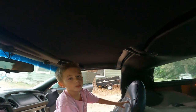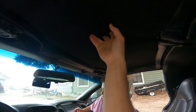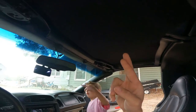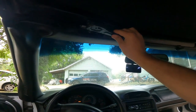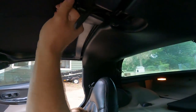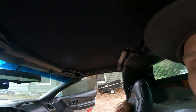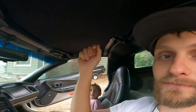What we're gonna be fixing today - it may be hard to see - but right there you guys can see the problem. The little headliner has always had issues and we're gonna try and fix that with a permanent, fingers-crossed solution. We're gonna have to take this off, and in order to do that you've got to slide it forward, pull and twist that, then push this. Now we can lift this off - we'll get out of the car, take it inside, take that off and put down the new stuff.